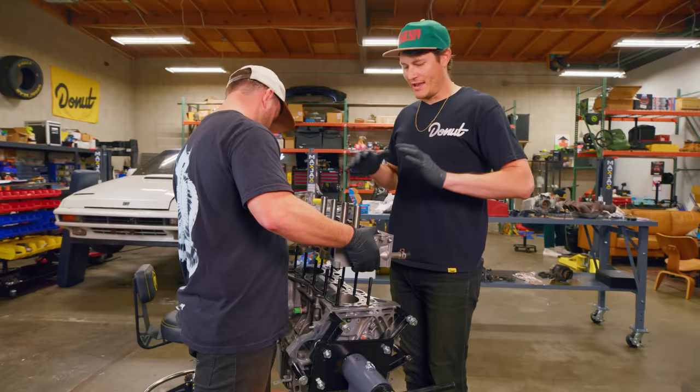We scared ourselves a little bit, but we realized that the timing chain tensioner is pressurized with oil from the engine. It was causing the chain to pull some slack and then get tight — but part of that is we don't have maintained tension because we don't have oil pressure yet. It's okay. Better we check now than when we go to fire this thing up.